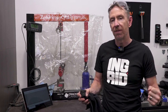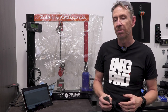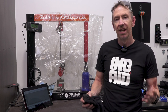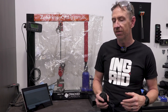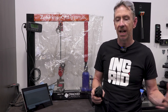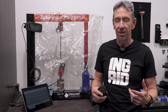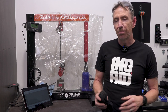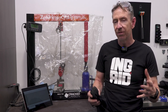With electronic, you've got these pretty powerful stepper motors, and they will pretty much ram that change home, and we just get a lot of failures with people shifting under loads that I don't think things are ever really designed to take. There's only so much one pin rivet can do if the pickup's a bit lazy and you're really pumping out the watts through that shift. Similarly, it's less likely things will break on a really clunky rear shift. The systems these days are so good and so slick on the rear that we tend to shift under much higher loads than we ever used to in mechanical. And it's pretty rare on road that you get a snap from a bung rear shift or a really crunchy rear shift.